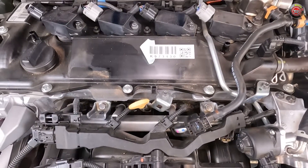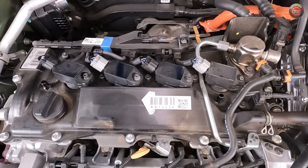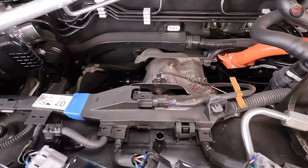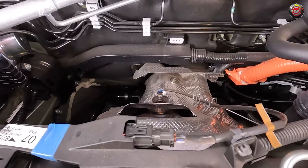At the top of the engine with the sound cover removed, you can see all four spark plug coil packs and they're easily accessed for service. Once the combustion process takes place, exhaust exits at the rear of the engine through a tubular exhaust manifold and directly into the catalyst exhaust system.